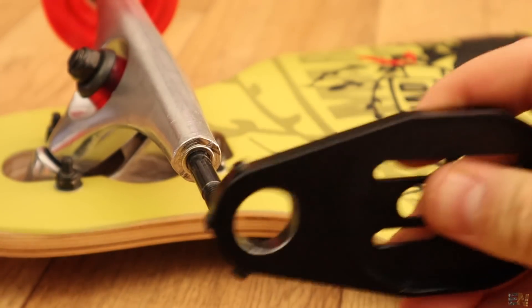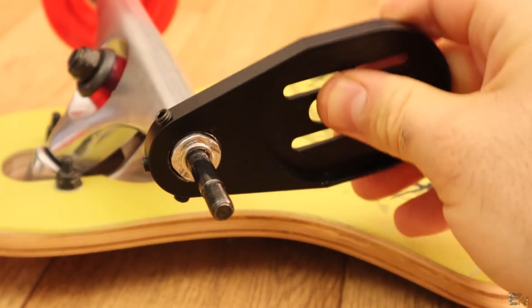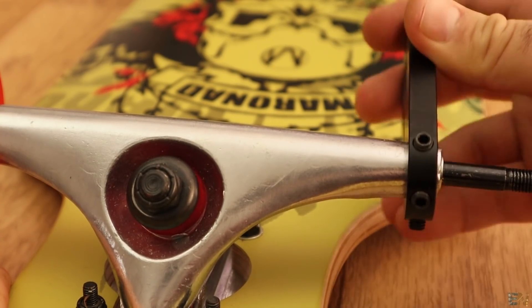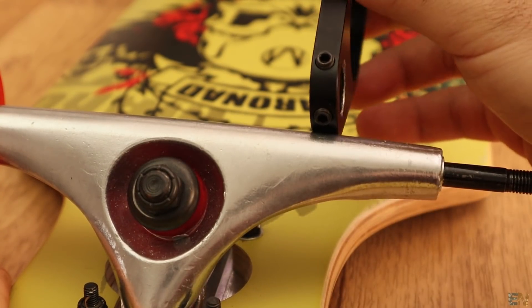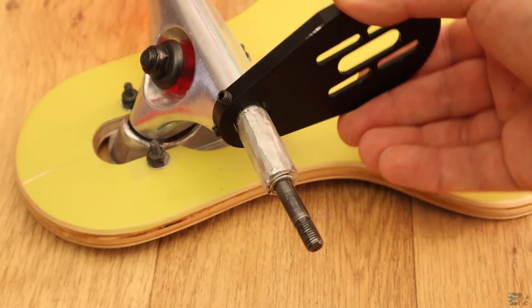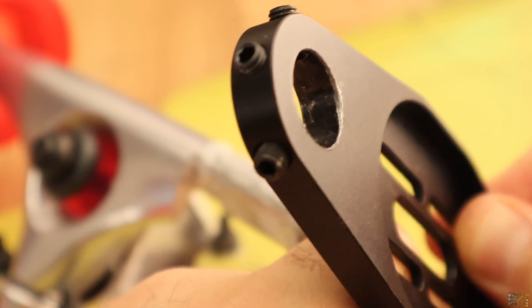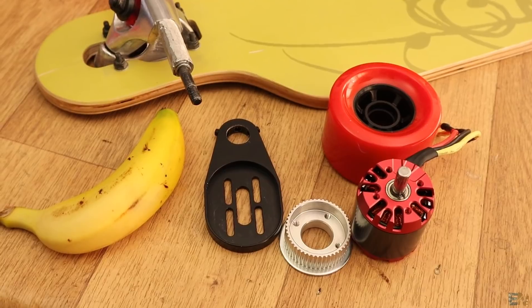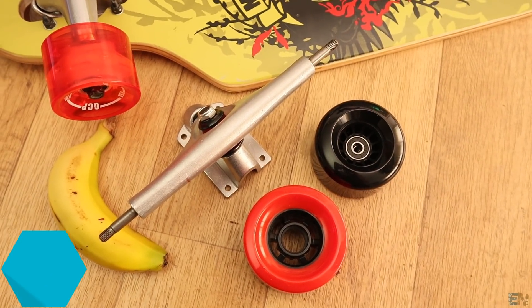Also, the diameter of the hole of the motor bracket is too small for this wheel shaft. It only enters on the tip and it should get almost around here more or less. That's why I had to cut part of the metal in order to fit. Also the bracket itself is not the best quality, so I would like to talk about all these problems and show you how to select all the parts for an electric longboard.